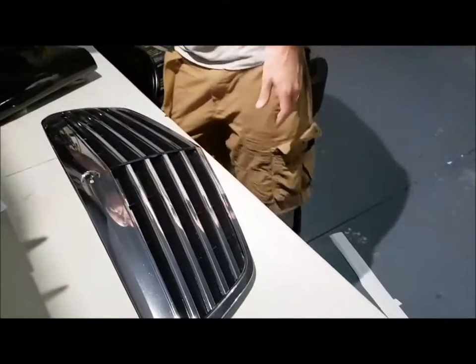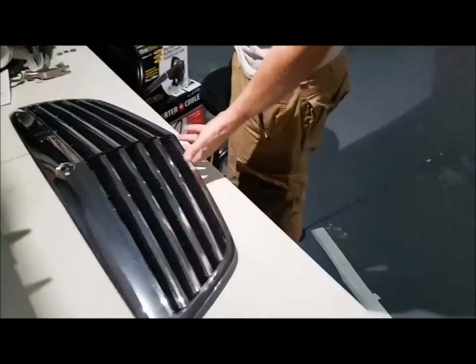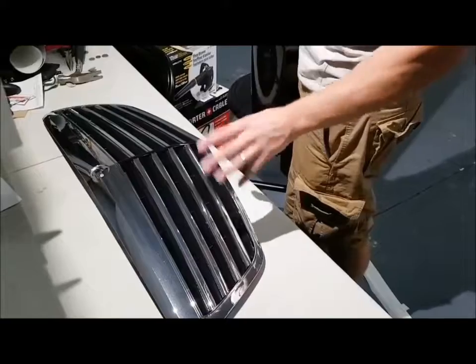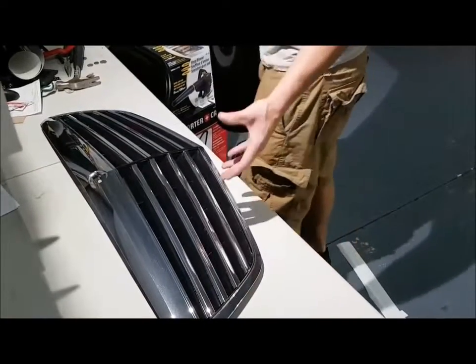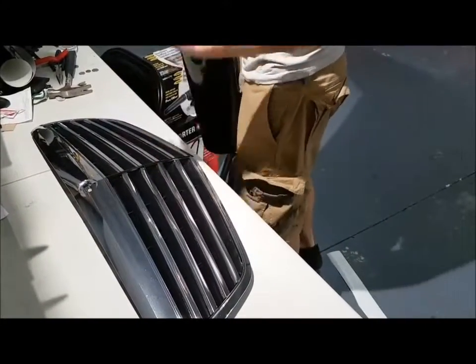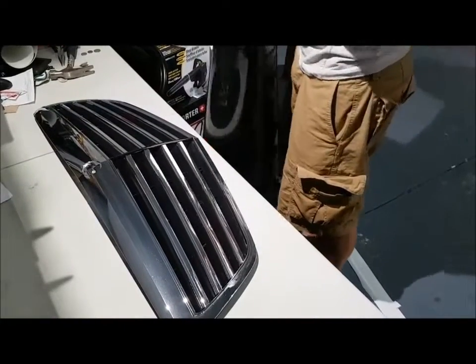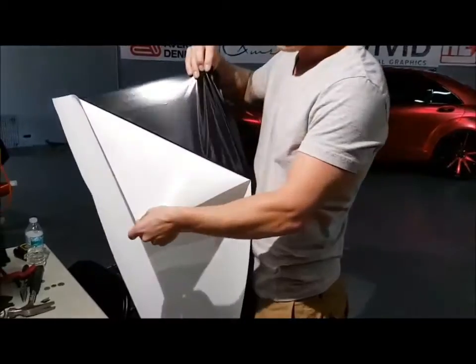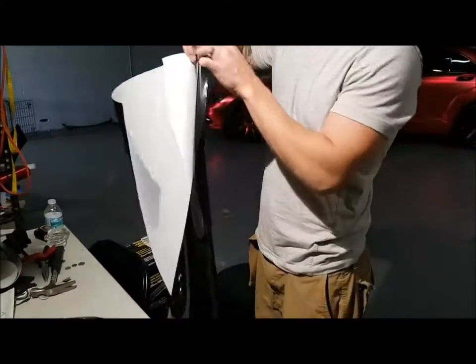So I've already done this like six times but we've handled the grill each time after that. I had to use a lot of isopropyl alcohol to remove the wrap — it actually helps to remove vinyl bits that are there. So if you ever dip anything on your car, isopropyl alcohol removes that pretty well. It's not too abrasive on the chrome finish.